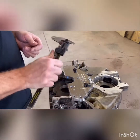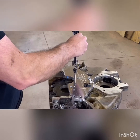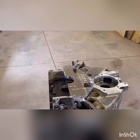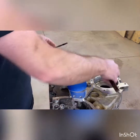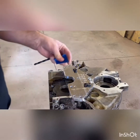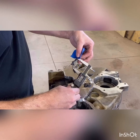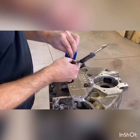Grab a nice set of cheap calipers — I don't even keep good ones around my own garage. Measure that total overall depth of the hole as it is right now. I got 1573. Lock that in. Now clearly I don't want to drill any deeper than that; I may get into passages you don't desire to get into. I grab just a simple piece of tape, put that on the drill bit. Measure out my approximate length. Again, this ain't rocket science — you got a little room to play with there.